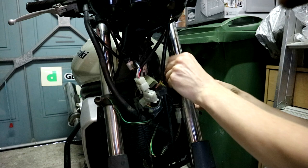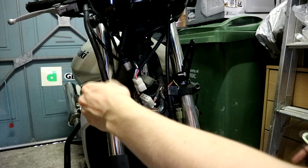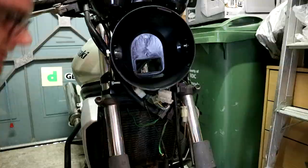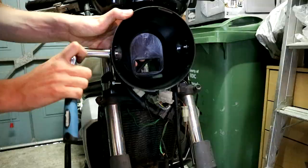It's worth bearing in mind it doesn't have to be totally rock-bustingly tight, because once you've got the other one on and both are holding it with the headlight in the middle to centralize it, this ain't going anywhere. With both brackets fitted, the headlight back can be slotted between the two and then bolted in place — surprisingly good fitment for a universal item, I'm not going to quibble over that. You don't want to go absolutely rock-bustingly tight with these because you're screwing into plastic — tight, but not "oh my god you're never coming out" tight. That housing is now on.